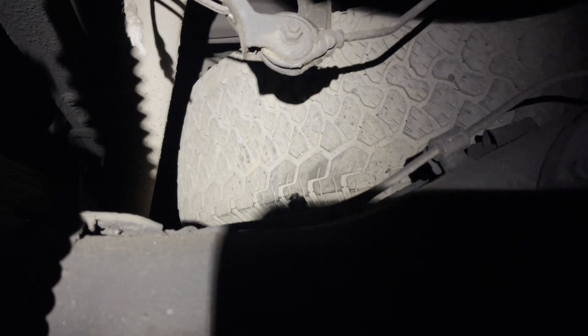It's tied to an existing hole already in the frame, up out of the way as if the truck is loaded. Now it won't be getting exercised all the time and start developing a leak like most other people experience. I'm not recommending you do this, but if you've lifted your truck and this sensor is no longer functioning properly anyway, this is an option. Alternatively, you could create a bracket and raise the mounting point for that stud it was connected to. Good luck.